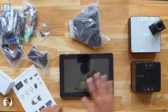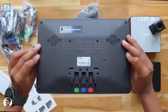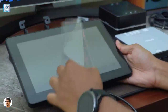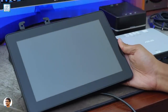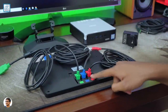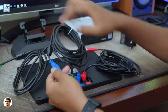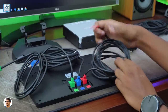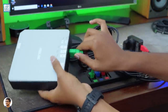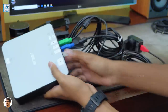Now I'll quickly show you how to set up the entire Hangouts Meet Hardware Kit step by step — it's a very easy process and you can do it in less than 5 minutes. All the instructions are in the manual. First, let's connect the touchscreen panel to the Chromebox. You need to connect three cables to it marked with different colors: green, blue, and red. Connect the green HDMI cable to the HDMI port on the Chromebox 3, the blue USB cable to recognize touch input, and the red cable for power to the provided power adapter. That's it — we're done with the monitor wiring.